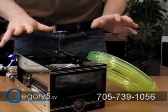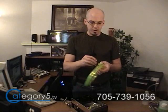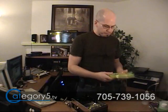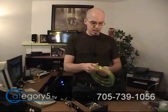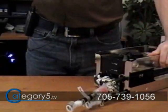Let's clear off this desk and get started on our liquid cooling system. We're going to take this right from the get-go and see how easy this is to install. Now, it's imperative when installing a liquid cooling system that outside of your chassis, before even thinking about installing it, you test it. You don't know if it got damaged during shipping — somebody could have dropped it or thrown it off a tall building. So we want to test it for the safety of your own equipment. We'll grab this hose included with the Big Water 780E and unravel it, and we're going to pull a small piece off — it'll be garbage at the end — but it gives us the assurance that this is going to work just fine without any leaks.